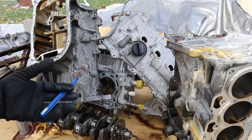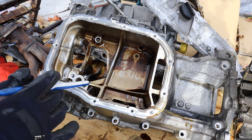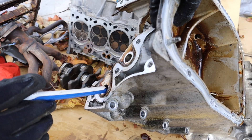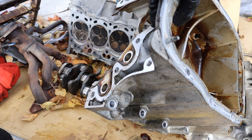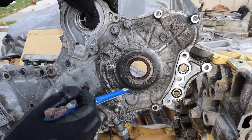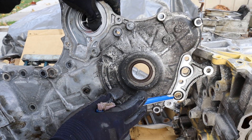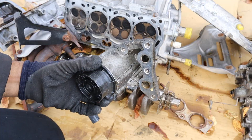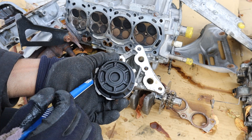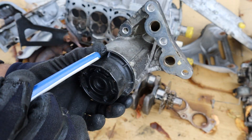So here we've got the engine all torn down. Let's have a closer look at some of the components. Starting at the bottom, this is the upper oil pan — the oil pump is going to bring in fluid up to here, then take it over to the timing cover, which drags it back around to the oil filter. One thing I don't like is that you've got extra O-rings here where oil is just passing through the timing cover — I don't really see why the timing cover has to play an integral role in the oil lubrication system and cause potential for oil leaks. The oil filter is a cartridge style with a plastic housing — which I hate because it always breaks. This one looks like an aftermarket replacement — it's not OE, it doesn't say Toyota on it.